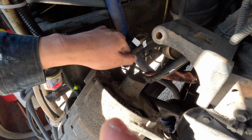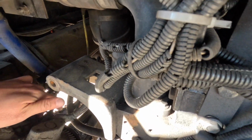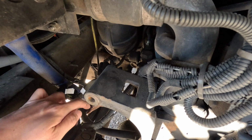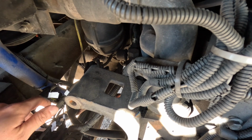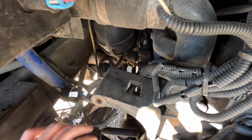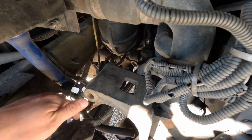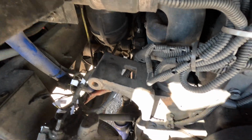and this in the back here, this one is number 2, and then this one here in here is number 3. I think this is for the tachometer, and these two are the ignition and the battery sense. Let's see, and this one is negative. Another one, oh sorry, positive. This one's positive, this one's positive, going to this big terminal here, and we are ready to remove them.